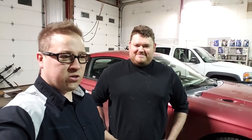Almost sketchy in the snow, very much so, because it is still winter. Front end has lots of bite, the back end does whatever it wants with any throttle input. Sean's been having a lot of fun with that, but there are a couple of minor squeaks — not enough grease on the bushings. Lessons learned: always over-grease. So now we're ready to tear into the front suspension.